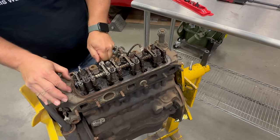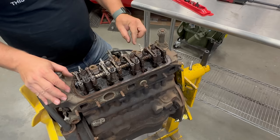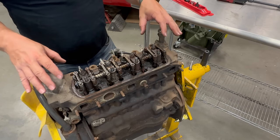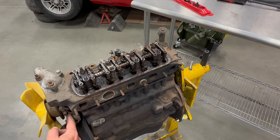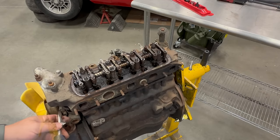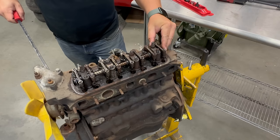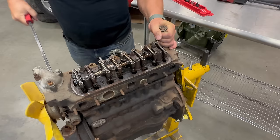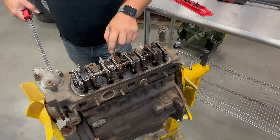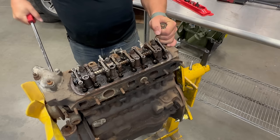We'll get these high tension leads off and out of the way — even these are stuck on because they've been on there so long, and the spark plug ends are corroded. The head should be loose now; the only thing holding it is the friction and all the rust that has developed between the studs and the head. I forgot about it, but there's a little bypass hose that comes up here from the water pump and connects to the head — I need to at least loosen the hose clamps. It feels like it's teetering on this one stud because there's a lot of rust in it, so we'll just work it back and forth until it comes up.